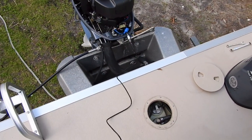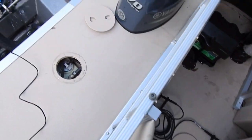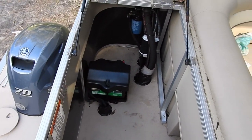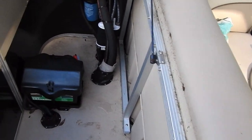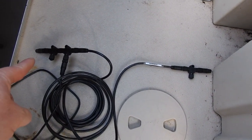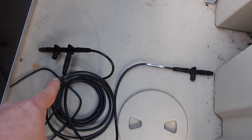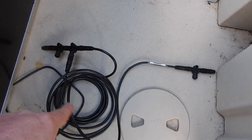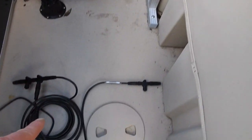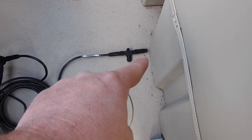We need to feed the wires to that bundle from the engine. One concern is whether the cable — which is 15 feet long — is going to be long enough underneath the boat to reach into the console about eight feet away. If that doesn't work, we have a second plan: run the cable through that bundle but up into the battery box compartment and attach the NMEA back there. In that case, we'd set up the NMEA as the terminator with power going to the battery. The center cable is still the Yamaha engine input, and a 15-foot backbone extension runs underneath the boat, up to the console, to the last T, into the Garmin unit, and then the NMEA 2000 terminator.